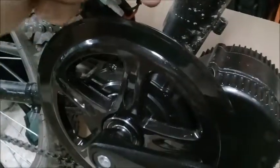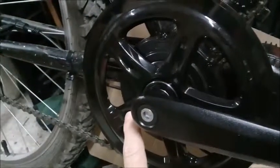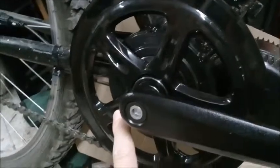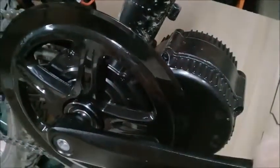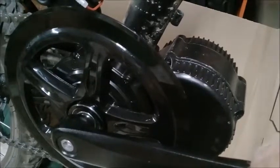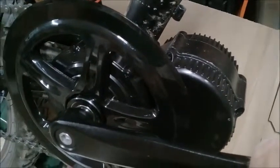When you put the guard on you have to work from the other side to put in the tiny little screws to secure it. I might be changing this chainset as well — it's a 46. I think I might want to put a 42 on it because it is hilly around here and I think that'll help. I did it over a couple of evenings, took my time. It's probably about the same complexity as putting in a hub motor wheel, which this bike did have.